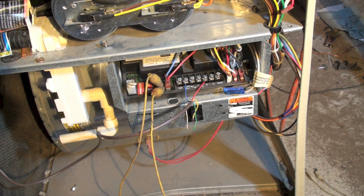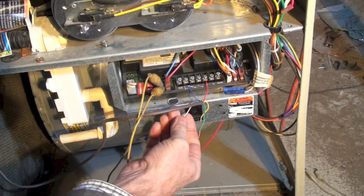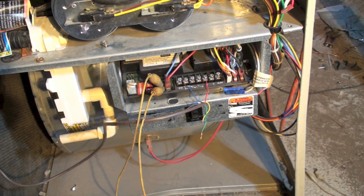I would go to the thermostat and disconnect R from the thermostat — do I still have a dead short? That's how I would troubleshoot that one. But let's say I hook it up to R and nothing happens, just fine. Then I'm going to take each one of these wires individually — I'll take W and hook W up and do the same thing.